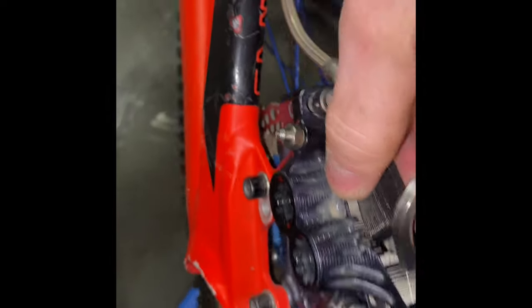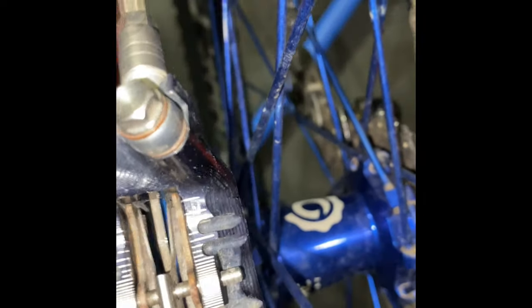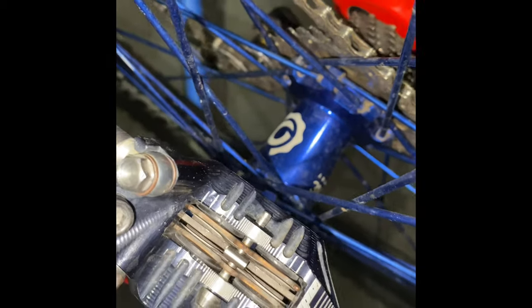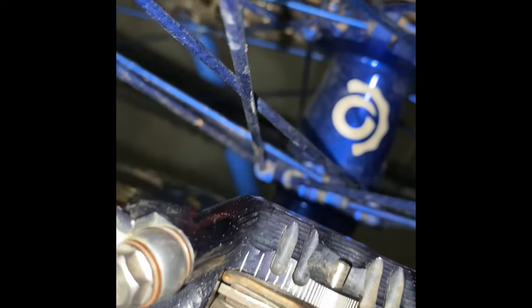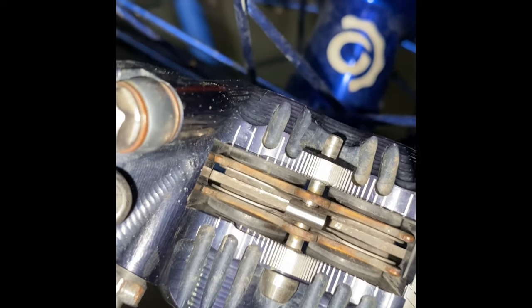You just get this thing out. Once you get your block out and you get your pads back in, you just advance your pistons and you should be good — but they don't always advance evenly. You can see we weren't so lucky with these. The outboard pad is not touching and the inboard pad is.